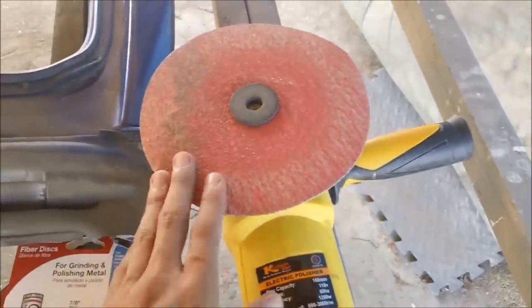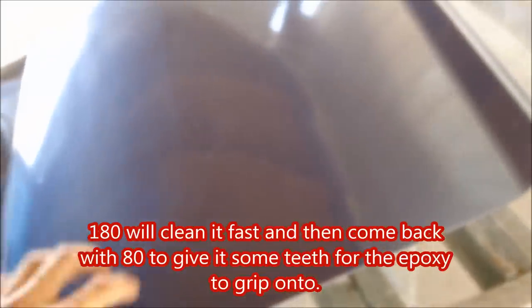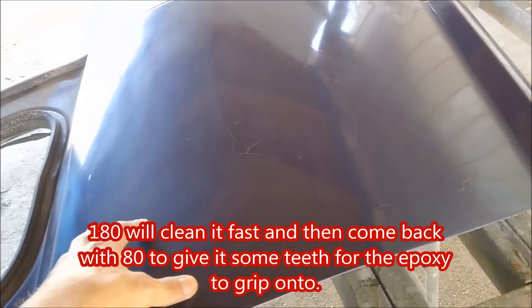Since this is a used piece of 36 grit, it's going to be a lot more mild. The other option I did was on the Camaro — I used a chemical stripper, the aircraft Clean Strip. What I like to do is put it on, get it relatively started, and then come back and grind the rest off. If you get your stuff sandblasted, you want to hurry up and get the car to where you're spraying, clean the metal, sand it with 180, hit it with 80 grit, and then spray a good thick coat of epoxy primer to seal it.